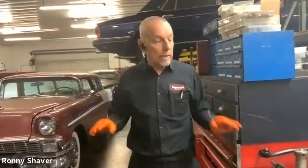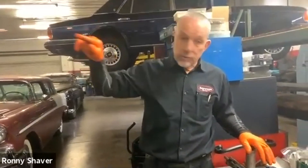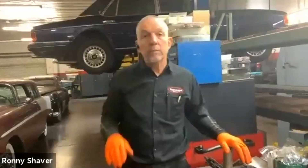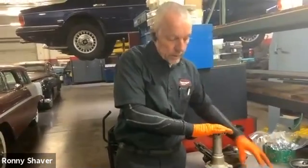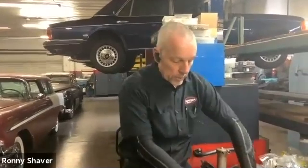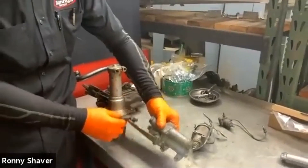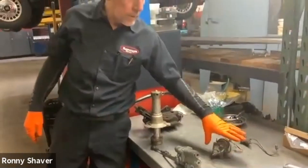This system is designed to bring the car back to normal height when you add weight. It's not designed to hold the car up at all times to a nice look — it's not designed for that. If you've got a car that's sagging when it sits on these early systems, then it's just springs. Your springs are sagging and getting weak, and you can adjust the springs or the shims, or you can replace them to bring it to normal height. This hydraulic lifting system is designed just to hold the car in the right position when you add extra passengers or luggage. It's adjustable — this height control valve has an adjustment linkage here. The earlier ones have shorter arms and a slot, but that has to be adjusted.